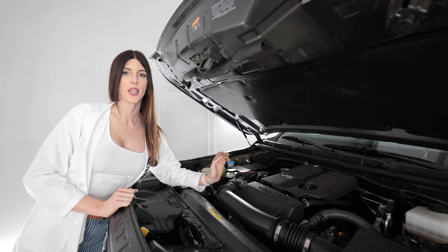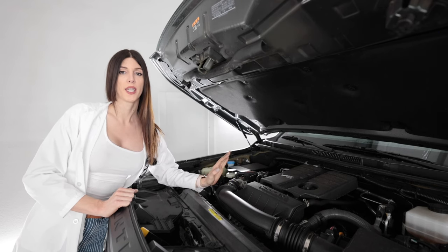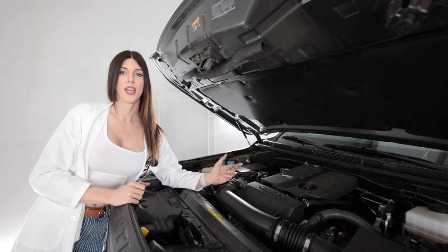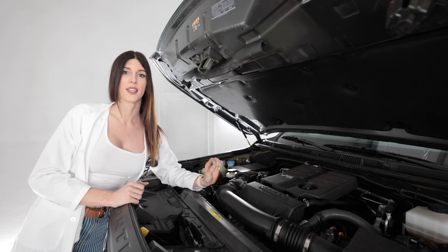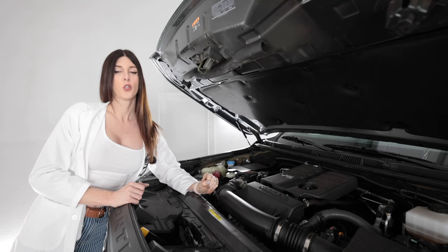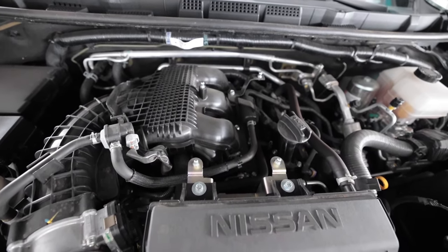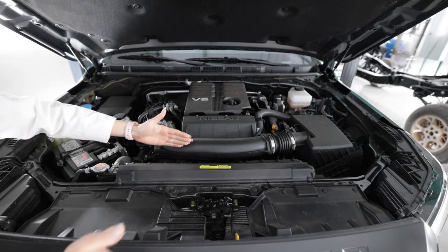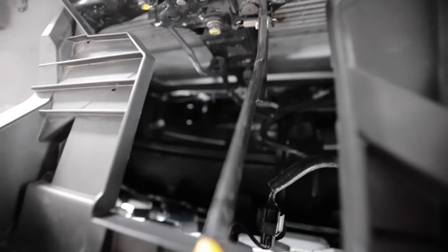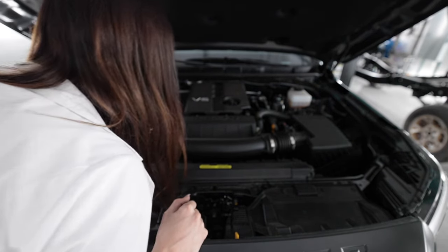Digging in a little deeper on this VQ38: it is a direct injection engine and doesn't have port injection to help wash off the back of the valves, which is the issue that direct injection-only engines have. It does have an 11.0:1 compression ratio and something with the variable valve timing they call VVT-CS — electronic control on the intake side but hydraulically controlled on the exhaust side. It is also an over-squared engine: 95.5 to 88.4 millimeter bore and stroke. The engine cover is made out of rubber, and a plastic cover on top just kind of flops over one of the banks of cylinders. I'm curious if you could still stuff a VK56 underneath the hood like you could on the prior generation Frontier.